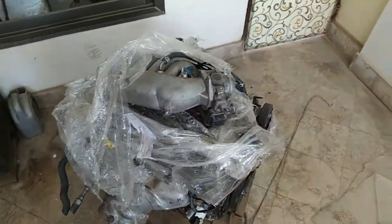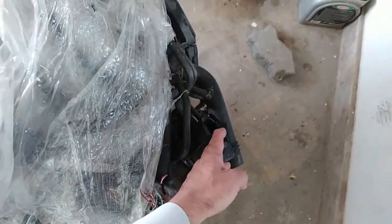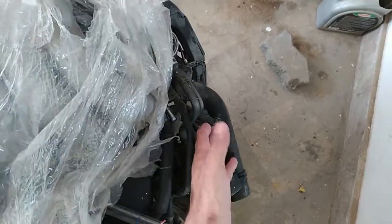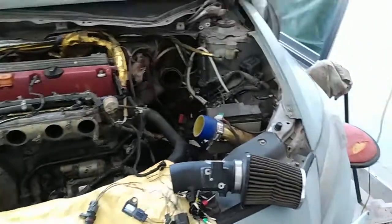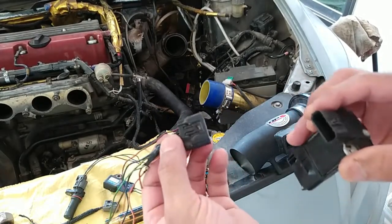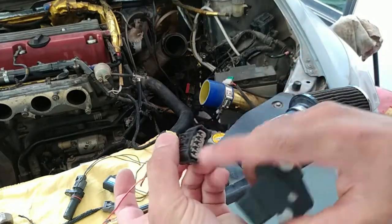Sometimes when you get the engine, they cut the air box — the plastic air box in which the MAP or MAF sensor was. So now that is cut. I am emphasizing that sometimes you have to use your CRD one or the Fit one. Let's try to plug it with the K series — this is the K20 or K24 series MAP sensor grip, a 5-pin grip. If you put it here you can see it is not going in, because this point is slightly above and this is slightly below.